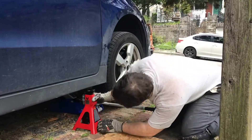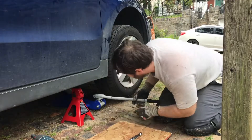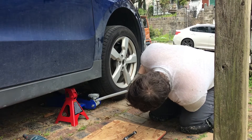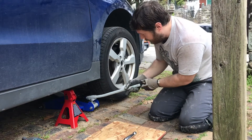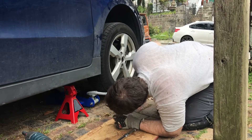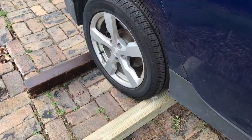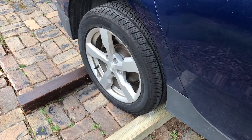With the car jack, I'll get the jack stand into the position I showed earlier and lower the car slowly down onto it. I'll leave the service jack in place just underneath the service jack location. Then I'll take off the wheel. It's always a good idea to chock your rear wheels with some 4x4s so that the car doesn't slide around on you.